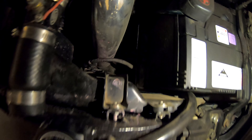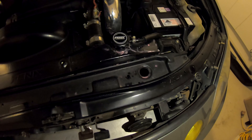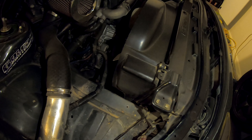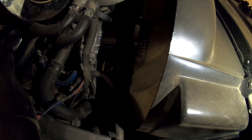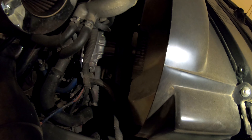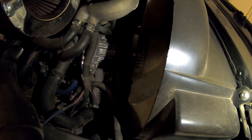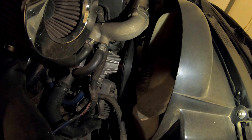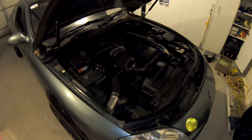The coolant issues aren't bad — it's definitely running cooler than it was, but I think that's because of the aircon fan running all the time now, drawing a little bit of air. The radiator is definitely helping keep it cooler while moving. It doesn't heat up sitting in traffic, only under spirited driving. I need to figure out which water pump is on this — there are 10-bolt ones, 11-bolt ones, and 60, 70, and 90 mil hub ones — so I may as well just take it apart, see what I have, and order the right bits.